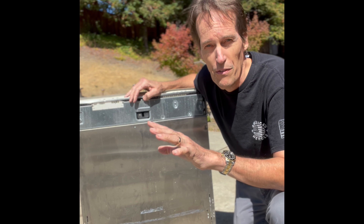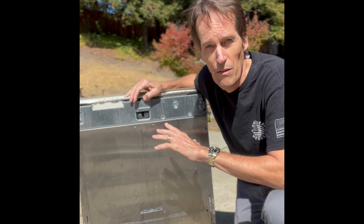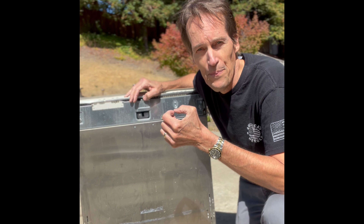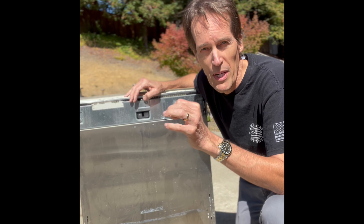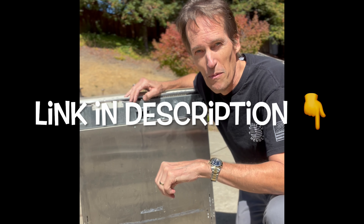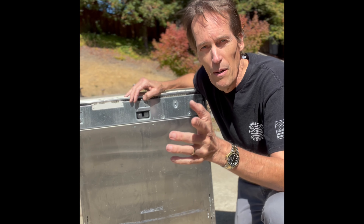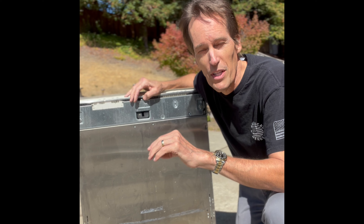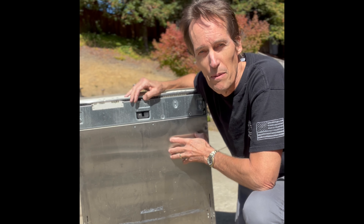The symptoms are pretty classic: starts filling, stops, starts filling, stops. Today we're going to learn how to fix the flow meter connection, and maybe even replace it if necessary. We'll put a link in the description below. My name is Scott, the Fix It Guy, and I've got over 30 years of experience working on Miele machines.